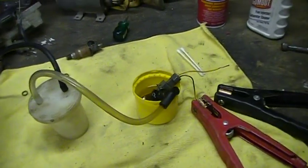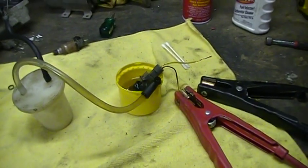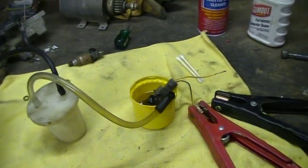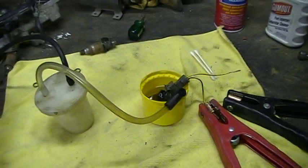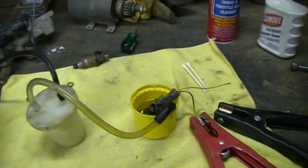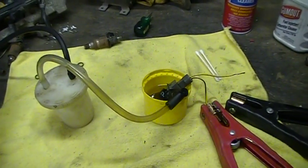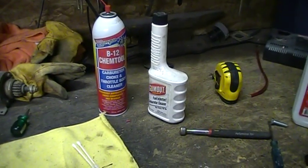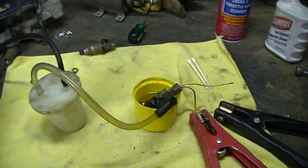So I cycle the vacuum on and off and I also cycle the injector on and off. Sometimes I just let it run with it full open for a while, but of course they're made to pulse, so they get hot if you let them run too long wide open. It's a solenoid, I believe, activated and doesn't like to be held open too long. If you take it out of the fuel or don't have the vacuum going, it gets hot fast because the fuel injector cleaner cools it down as it's cleaning.